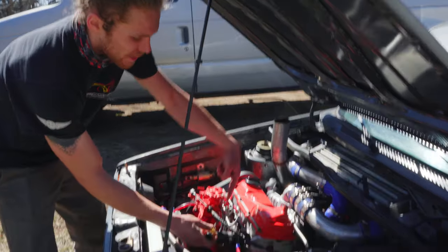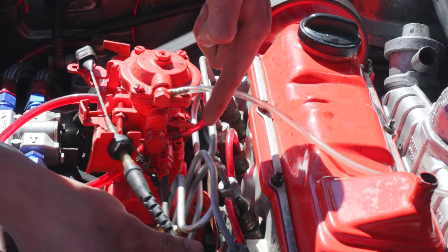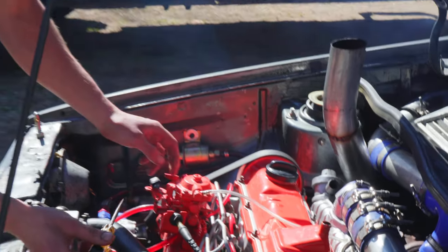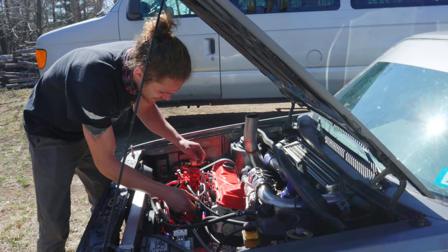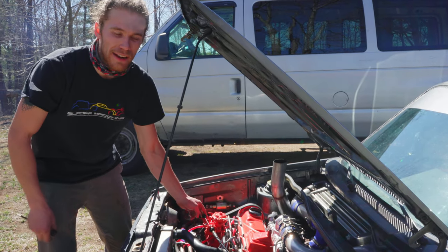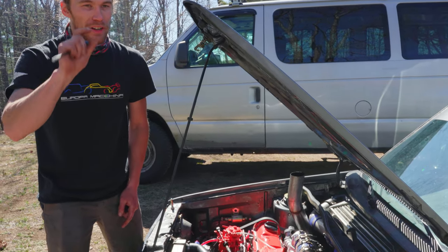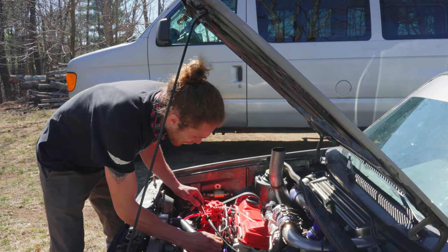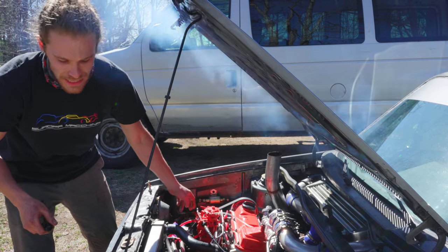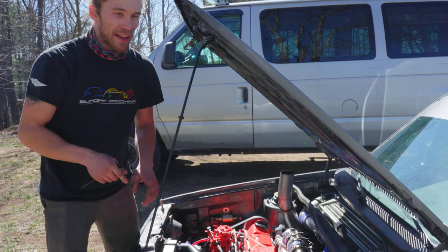If you're looking closely, the screw right here beneath — I'm turning it this way to increase fuel. See how it's starting to lag a little bit? Do you hear that? That, right there — that's rev hang. I don't want it. We're going to go back just a little bit. Perfect. I like that. More fuel. No rev hang. Beautiful.